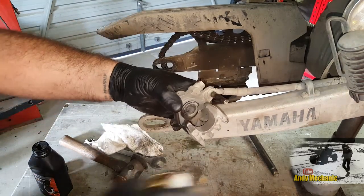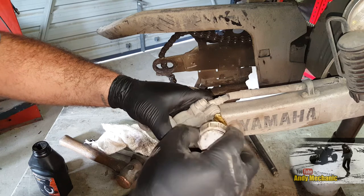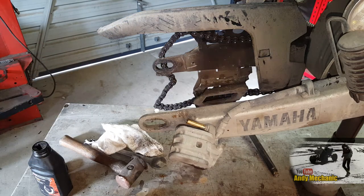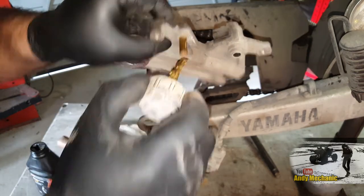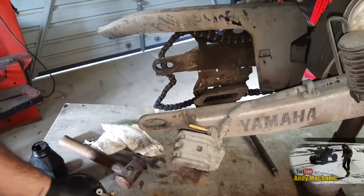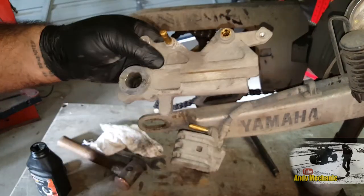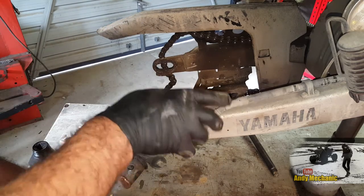Copper paste. We use copper paste because it's heat resistant. And if we'd just fitted the brake pads in situ and not taken the caliper off, we wouldn't have seen any of this. That's the problem. Let's slap those back together again.